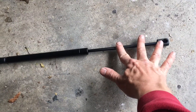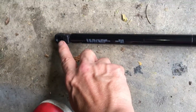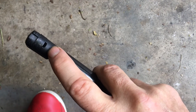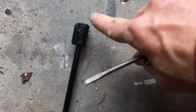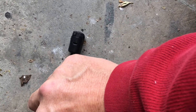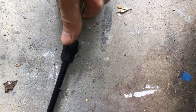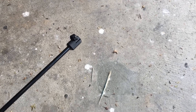This is what it looks like out of the package. There's a ball joint on each end — one here, which is the female side of the ball joint, and another one here. The male part of the ball joint is on your hatch. To put these on, you want to loosen this clip here and this clip here — I usually just do it with a small screwdriver. You jam a little screwdriver in there and pry. I like to get them loose but not take the clip off all the way, because it's just easier to put back on.